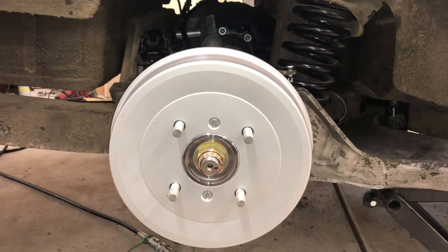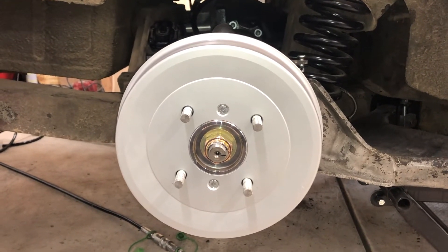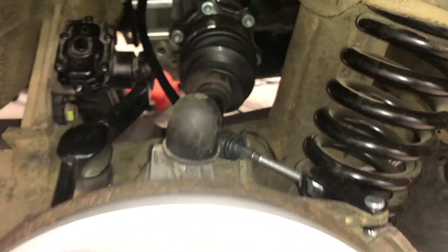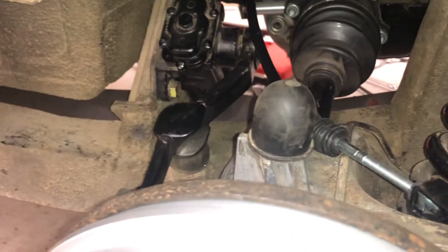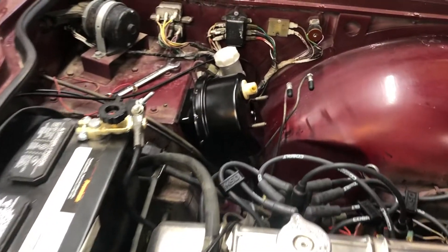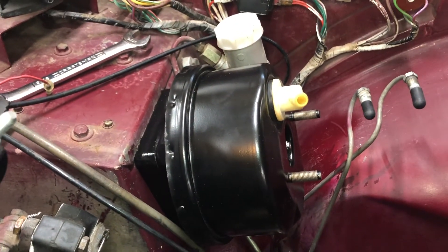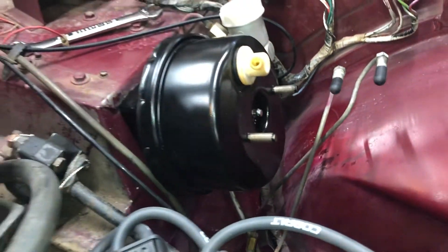There's a nice shiny new drum — I painted it up when I got it since it was just raw metal, just to make it look good. Everything's all hooked back up with the new parking brake cable, and I have everything adjusted so the drums just drag a little bit when you turn the rotor. I still need to put the brake servo on — I got it rebuilt from Brake Parts and Materials in Indiana and had it powder coated. I'm still working on adjusting the clearance on the push rod, and then I'll get the new master cylinder.